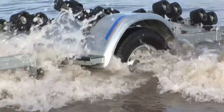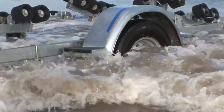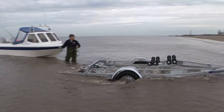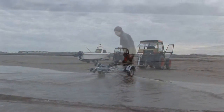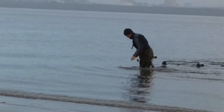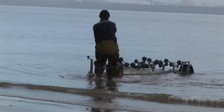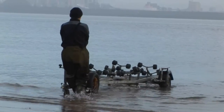In most small boat launching and retrieving scenarios, submerging the trailer hubs and brake drums is unfortunately a regular fact of life — something that simply cannot be avoided regardless of the consequences for the bearings and the brakes. If trailed units with a gross laden weight exceeding 750 kilos were not required by law to have brake wheels, the vast majority of small boat owners would operate without them. But it is the law, and for those dipping their wheels in corrosive salt water, it's a constant maintenance battle we have to deal with.